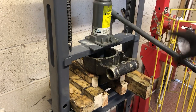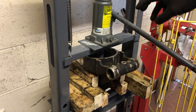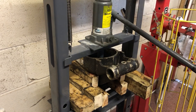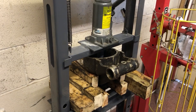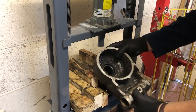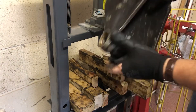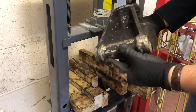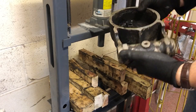I'm using blocks of wood around the hub carrier to hold it in the press, and a 30mm socket — just undersized — to push the hub out from within the hub carrier. It seems to be drifting out nicely. Lifting the hub carrier away, what always strikes me when I pick these up is how light they are. Of course it's an aluminium casting, but it really is extremely nice.